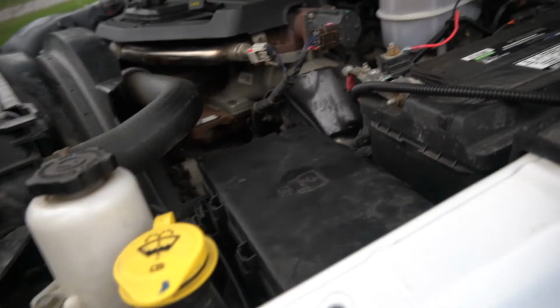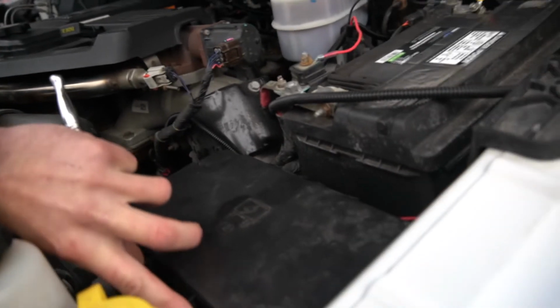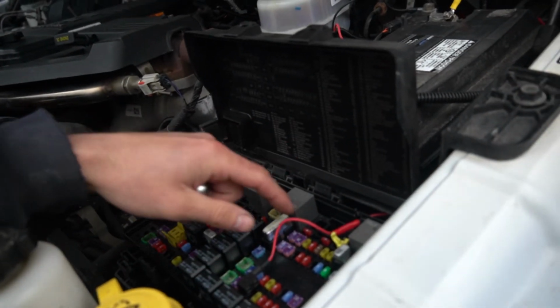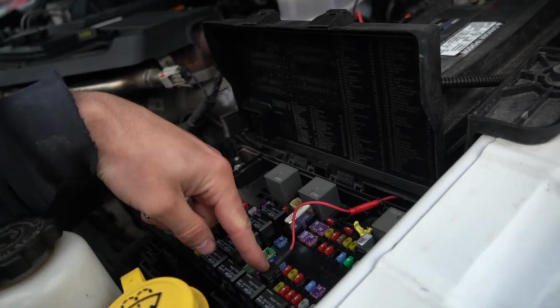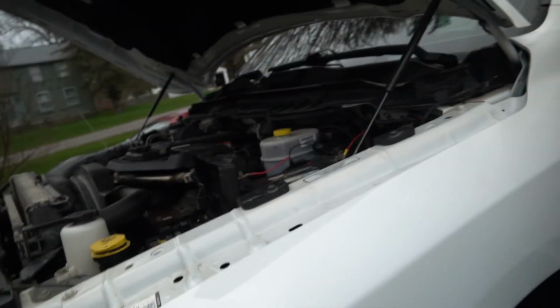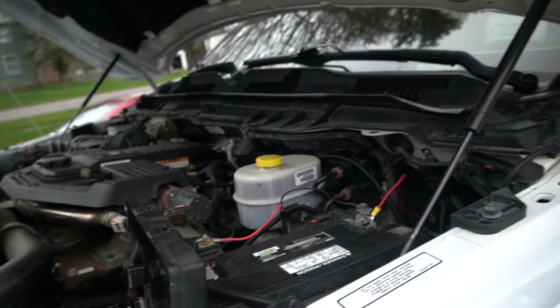And then in the fuse box here, we've got the other power wire run into a fuse slot. So I'm gonna pull this out, clip it off, and then stick the fuse back in there so that I can pull all that back out and not have it up here so that those red wires aren't just sticking out looking messy. Now, of course, those are two other legitimate spots that you could run your power and ground from for your Isspro gauges.